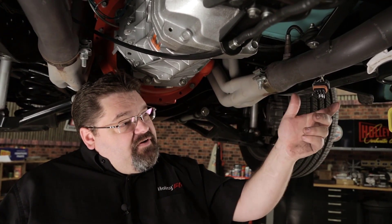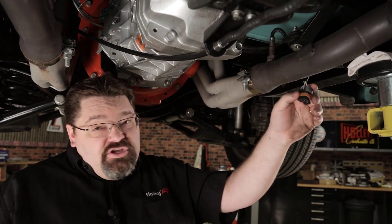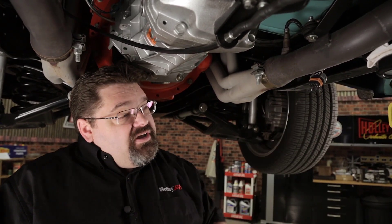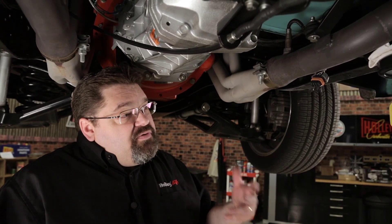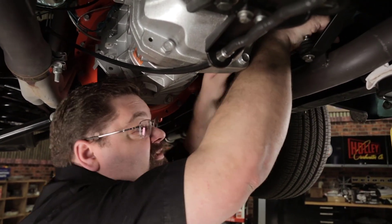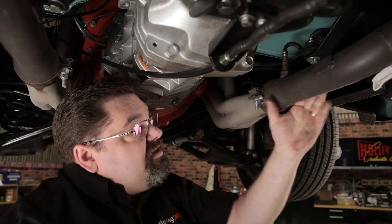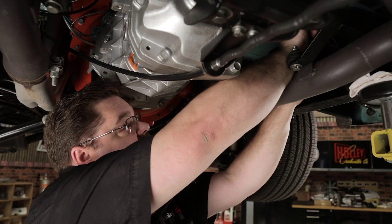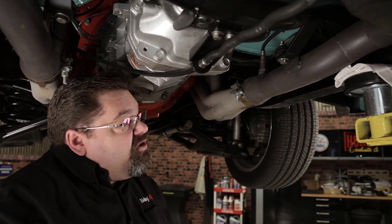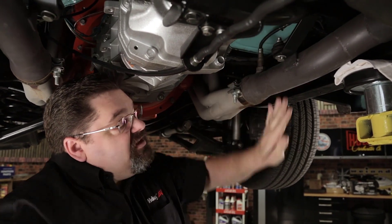If you've read your instructions and followed the notifications including the label on your O2 sensor connector, you shouldn't have it plugged in yet. It's important to make sure you've programmed the global file for the right oxygen sensor before connecting it — otherwise you can damage it pretty quickly. Since we've got our global file loaded with the right O2 sensor setup, I'm going to go ahead and connect it and plug it in, then zip tie it securely up to the frame rail and away from high temperature and moving parts. I'll trim the zip tie edge to clean up the installation.